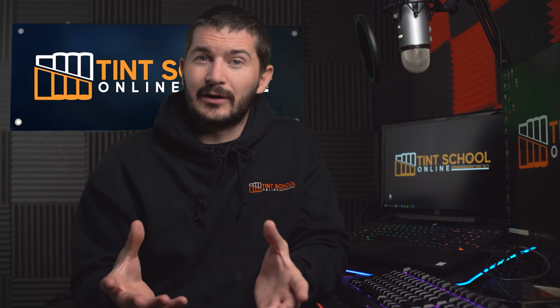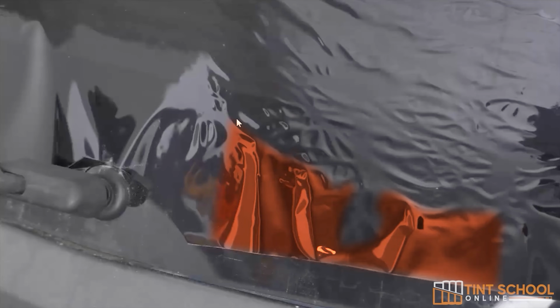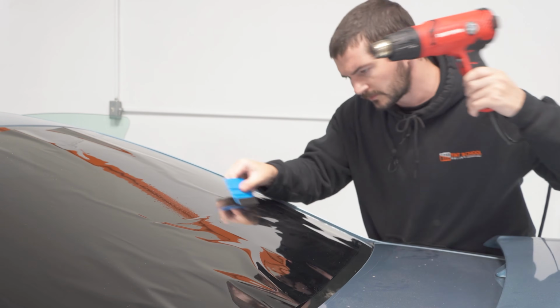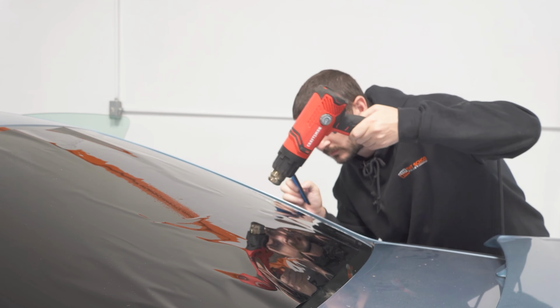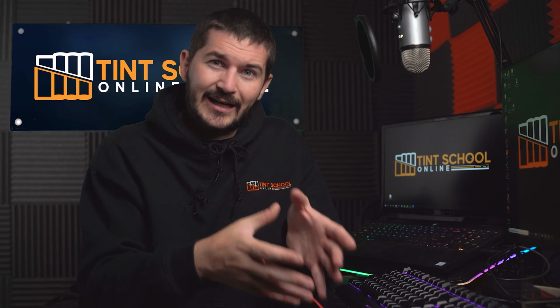Don't fall into the pattern of what you're doing if you don't really know what is happening when you're shrinking the film. And yes, in our training we do say stick to a shrink line, but you still have to understand what is happening to the film. For instance, you have to look at what is happening as you are heating it. Does it need a bit more heat? Have I heated it too much? Or is this going to be primed for a crease if I carry on?